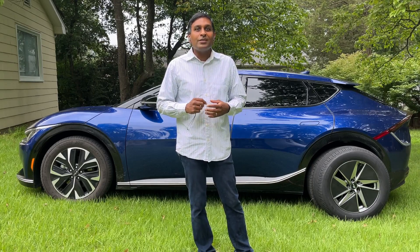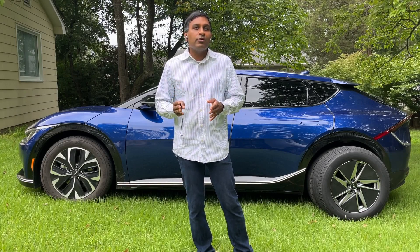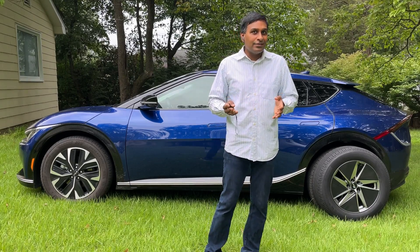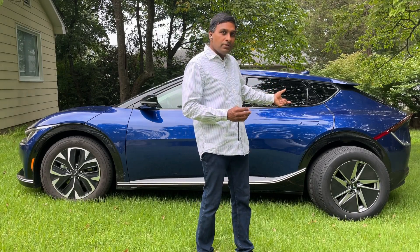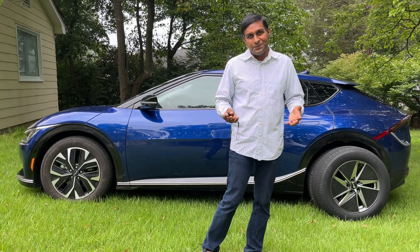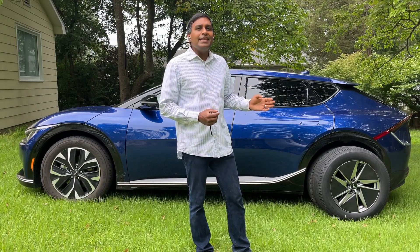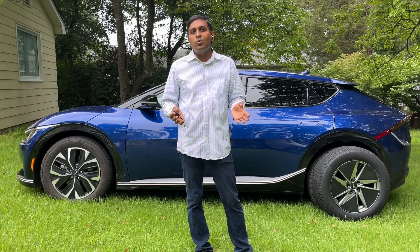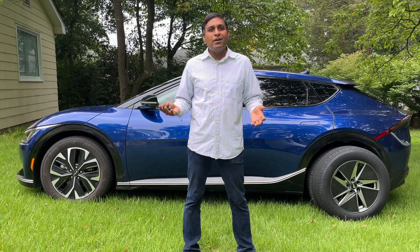For friends who have a Tesla, those are great cars but they are more sporty oriented — the suspension is more focused on sportiness than comfort. So if you get a downsized rim with a thicker sidewall, you can meaningfully improve the comfort of a Tesla vehicle.